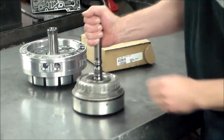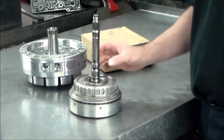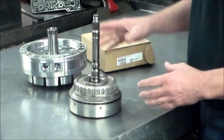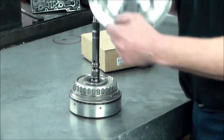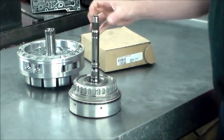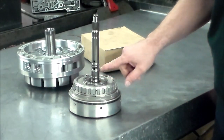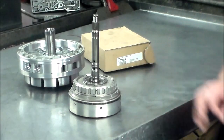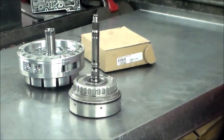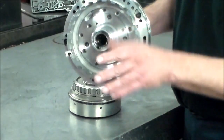When putting these back together, you've got a couple of rings on here — make sure you grease these in real good so they do not open or spread as you're putting the pump in. Because there's the C-clutch that sits in here, I load everything up and use a vice grip or something to grab it and set everything in at once. Make sure these are greased in real good. I load it up with TransGel because as soon as it heats up the TransGel will melt, and the rings will be in place and intact — they can spread apart and break easily and you may not notice it. So grease them in nice. The rings here are real steel, so just grease those up and you shouldn't have any problem there, but these are the ones you've got to be careful with.